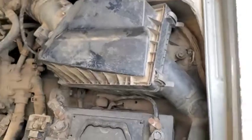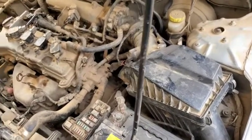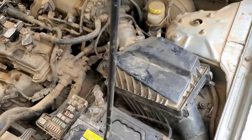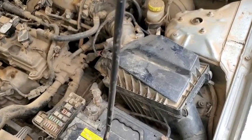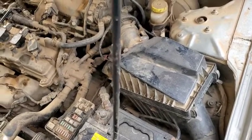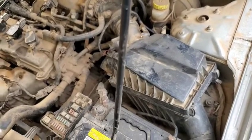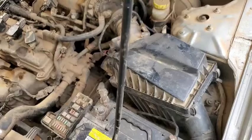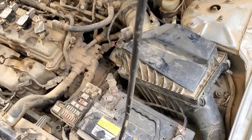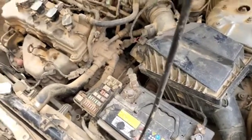I want to make some quick checks because based on how this engine looks right now I can tell there are some other things which are probably wrong. I'm still running some diagnosis. As you guys can see right now, we've actually confirmed that the car is throwing some blue smoke out, but we need to test drive it and see if the smoke stops — if it stops, that can be indicative of a bad valve stem seal.